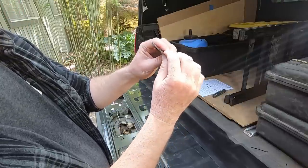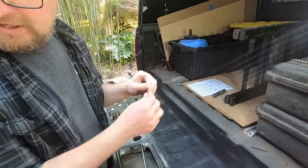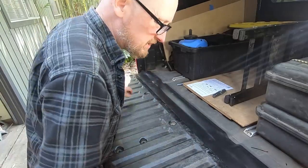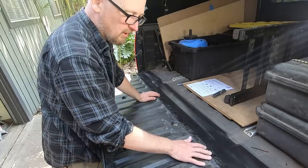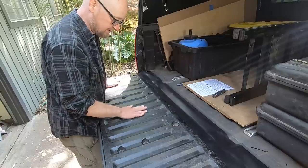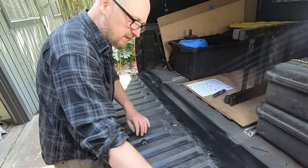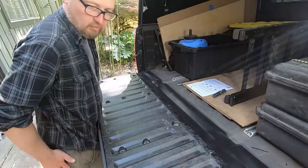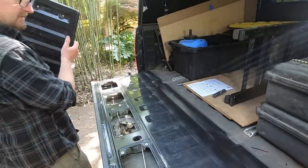This rubber is pretty thick, and where the adhesive is, it's even thicker — it's good and tough. I'm a little concerned about how well I'm going to get this back on there. The instructions definitely say this needs to be underneath anything like this, and I didn't want to put it on top in case I decide to replace this with something else — just a flat surface instead of this ribbed thing. The tailgate has to sit open for at least 30 minutes before you put any stress on that adhesive, so we'll see about this later.